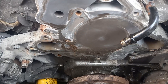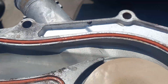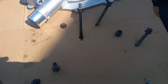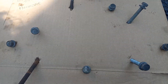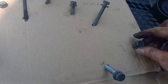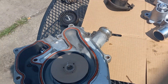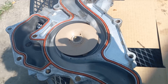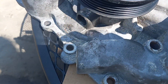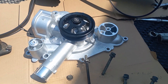That's what you want to clean — that surface good, but don't scratch it. You want to get it as clean as you can. Here's the old water pump and there's the new one. You can see how I got every bolt accounted for where it goes. Look at the size difference of all these bolts — long, these ones are short. You have to be very careful because there's a reason why they're long and short. You can see it was leaking — all the corrosion and stuff. I'm having overheating problems.